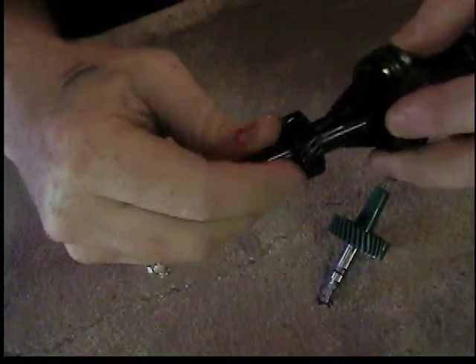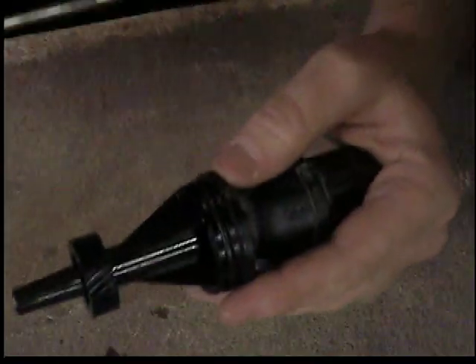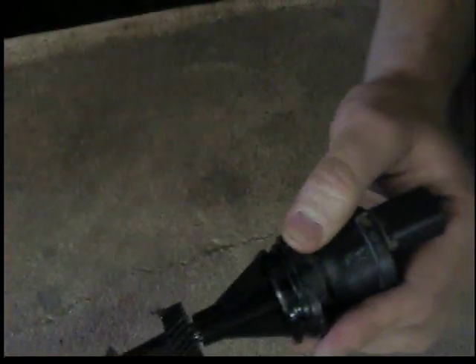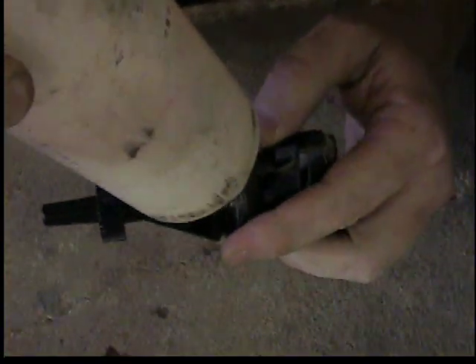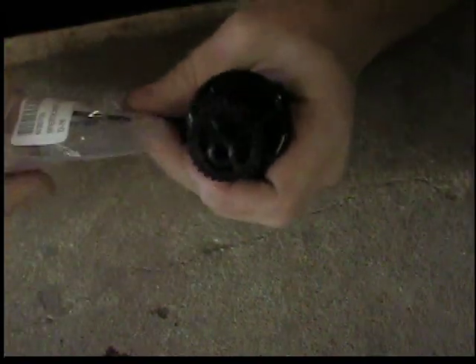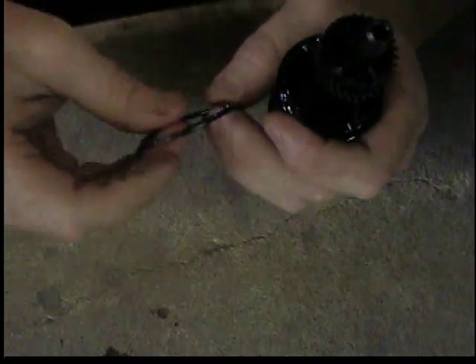While I'm at it, I'm going to replace the o-ring. They're cheap — don't want it to leak. I'll pick the old o-ring out with a screwdriver and clean that area up, down in the groove and such. I'll put some assembly lube on that as well, and I'll lube up the new o-ring before I put it in. It's just best to have all this stuff wet before you install it, and that reduces the chances of tearing the new o-ring.